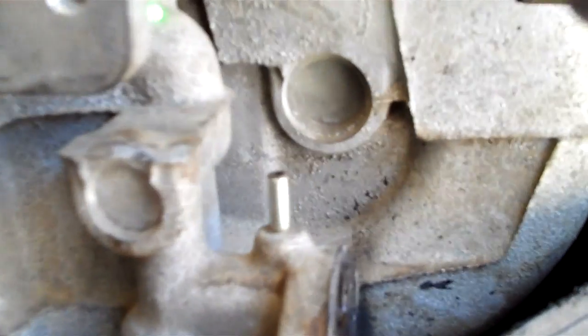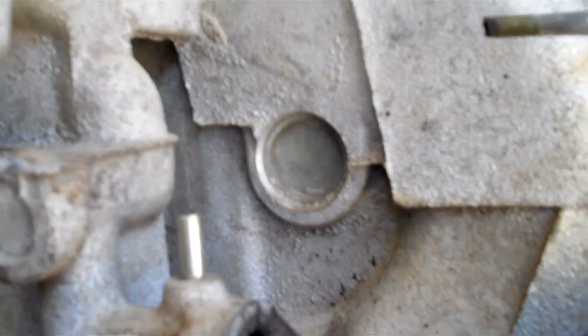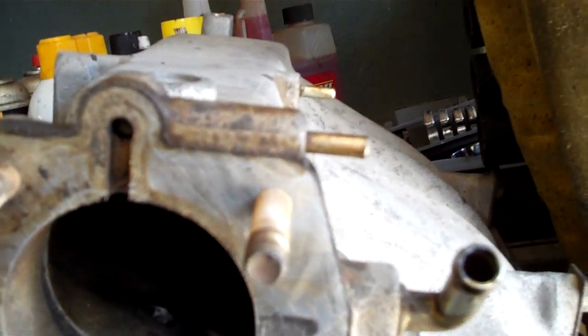So this little hole here — that's what we're looking into, you can see it there. That was totally blocked off. And where that goes is it goes down through here, and then out through this top hole. You can see that they had to cap and drill here to get that thing to go that way — they did the hole before they cast the two parts together maybe. And then there's another cap here. So this thing's winding, going all over the place, and they had to do another hole or cap just to get to that. So if you're not going to get all those caps out, you've got to do something to clean that out. That's where the B12 Chem-Tool comes in. Just watch this stuff pour out — it comes out black, then kind of caramel-like, and the next thing you know it's clear.